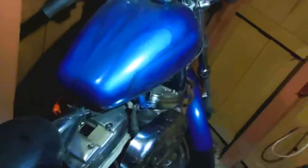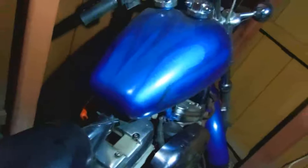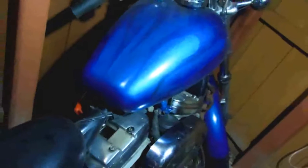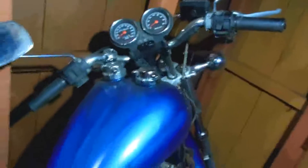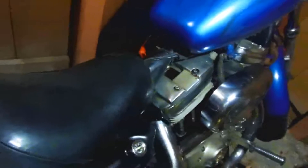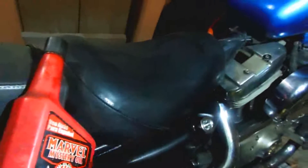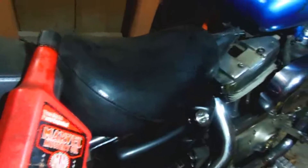Sometimes when you're out trying to start the bike, that's a trick to get it going. What I like on this bike are two things: that spark gauge, and I know the plugs can be troublesome, but I've got them set up insulated with tape, rock solid — they're not going to pull off. I can see the spark going to the bike immediately. The other thing is I can see the voltage of the battery and whether it's charging. Every week I've been running this thing, and since I'm starting it in wintertime I don't have straight-weight oil — I've got 20-50, or you could even run 20-20 or 10-40 if you're way up north where it's really cold. I always run some Marvel Mystery Oil in the gas for upper cylinder lubrication when you start it up in wintertime, so you're not scoring the pistons.